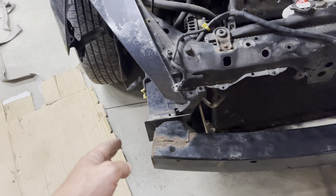The crossbar across the top is in and our rear bar got a good enough weld — was a little hot, melted a bit too much into the door, but I feel like we got a good grip. Put the stock fuel cell back on and flattened that out. In the morning we just need to pull the wiring forward and secure it, secure the battery line, then spray foam up front and tidy up the lines. We cut our roof sign — going to throw a quick paint job on in the morning and HUD is going to help cut out some stencils. Pop up the trunk and that's our final look. We feel like we're in a good spot — just got to get the cosmetics and outside stuff done, then she should be ready to rip.